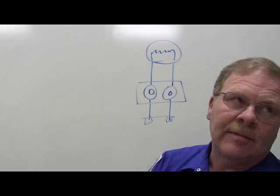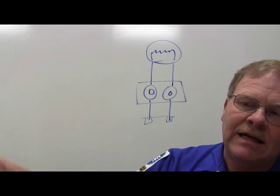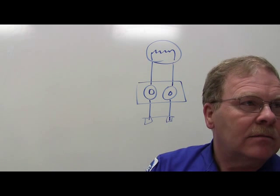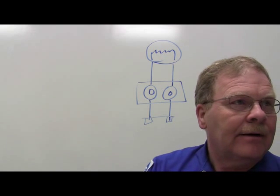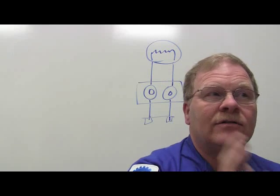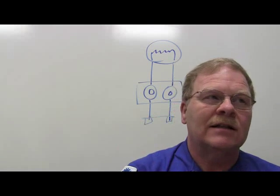Okay, so on some of them that don't have a fuse feeding that cigarette lighter, like the little 92 Taurus, if a penny gets down in there, the darn thing will kill the battery overnight because of a penny in the cigarette lighter. You know what I'm saying? So learn how to look at those schematics. Learn how to track that kind of stuff down, because if you don't, you will crash and burn in this business. So you need to be able to fix electrical stuff.